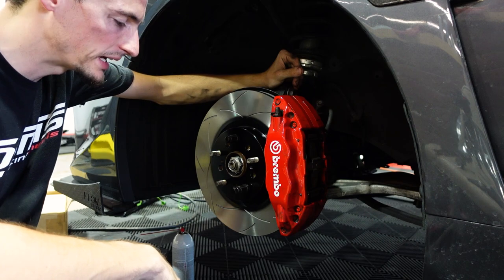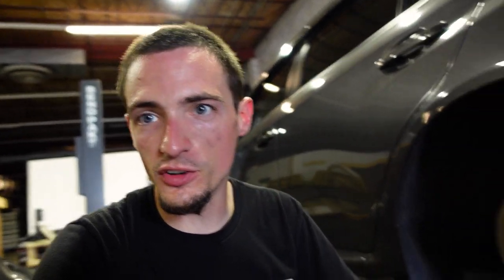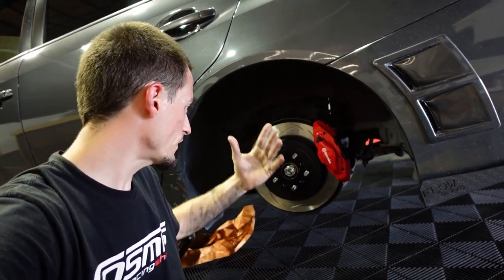I didn't really intend on this being a how-to video, just kind of like a vlog. It took me like an hour — maybe an hour and a half — to do all four brakes, which just feels like a long time. The pads were so low I really had to compress the calipers to push the pistons in to get the new pads in. All my rotors were seized, so I had to use the bolt to push them all off. But the new brakes look great. Hopefully they function as good as they look.